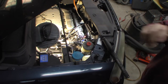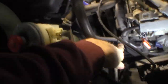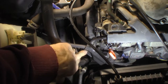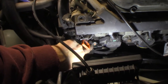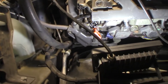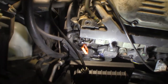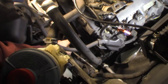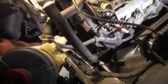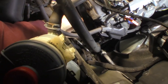Let me show it to you so you know what I'm doing here. Right here is the 10-millimeter, right here is the 12. Battery is disconnected — that's just to get the harness out of the way. Then we'll work on getting the serpentine belt. Down here there's a 19-millimeter — that's your tensioner. These are pretty stiff, so we'll be undoing that and getting this belt out of the way.